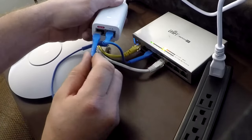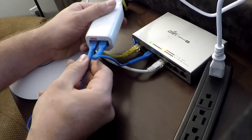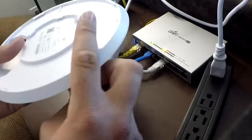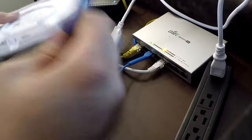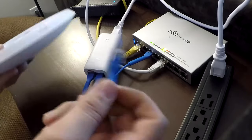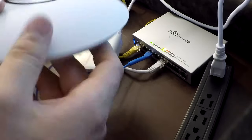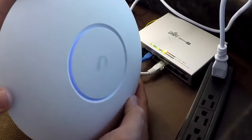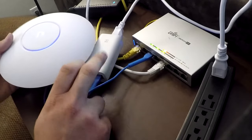The next thing we do is take the other Ethernet cable — because you do need two of them — and plug it into the PoE port. Then I have my UAP-AC Pro access point that we're going to power up quick. You want to take your Ethernet end and plug it into the main port on your access point or whatever you're powering up. You should hear it click just like that. And as you can see, it is starting up — it should be white for just a little bit, which means the PoE injector is working and it is powering it up.